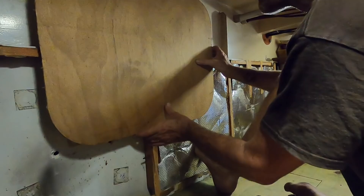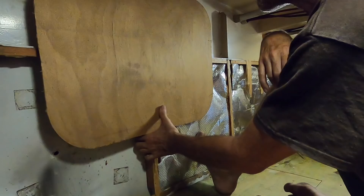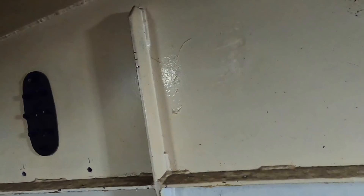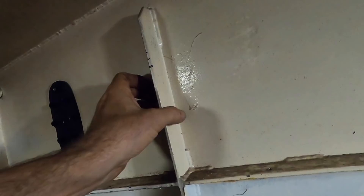This is the template for the hatch. It needs to be high enough up to clear the mattress and low enough to leave a good chunk of steel acting as a rib across the back. The timber was here just so that the ply and carpet could go on — that can all go. The bracing on the bulkhead is only stitch welded, so I'm thinking of cutting into it in places where there's no welding to take a section out, then turn the template into a ring template to mark and cut the bulkhead. I think that's going to be the easiest way.